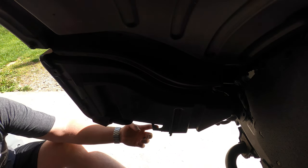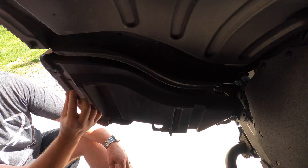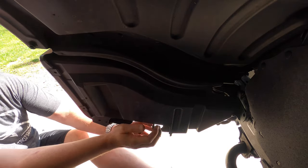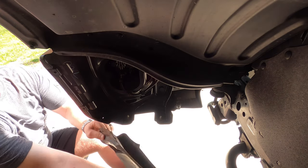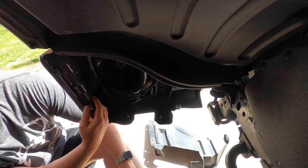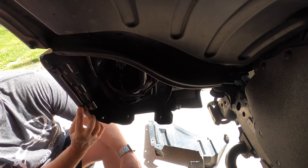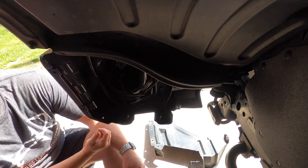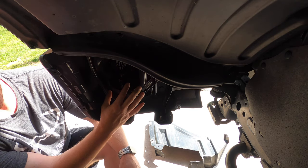Once you remove all of the bolts and that pop clip, the panel just comes loose like this, but it is held on — there is kind of a bracket piece over here. In order to get it out of there, you're just going to pull away and down, and it'll pop out. The bracket piece stayed on the truck in this case; sometimes it will come off with the plastic trim piece — no big deal. There are a couple grooves where the 10mm bolts came out, and the bracket can only go on there one way.